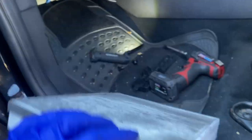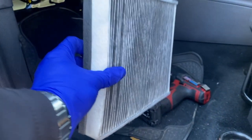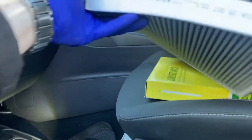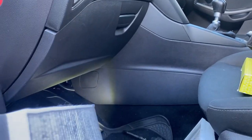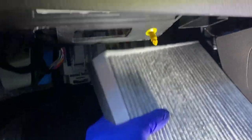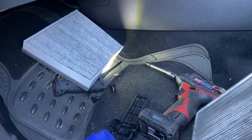Yeah, it's pretty dirty — quite black. This new one's just a normal white one. Look at the bottom — it says airflow, and air is going this way into the vehicle. So when we put this one in, check the bottom says airflow — not to go in like that. It's quite heavy and thick this one, so hopefully I can manoeuvre it. Basically just push it in, push it back up into there. Push this cap back on and it should be good to go.